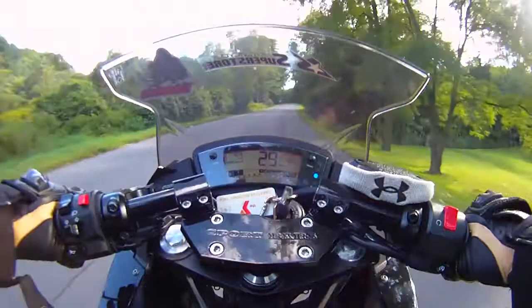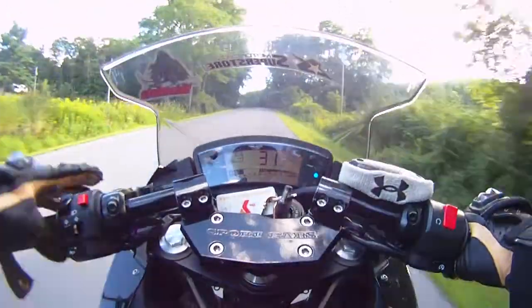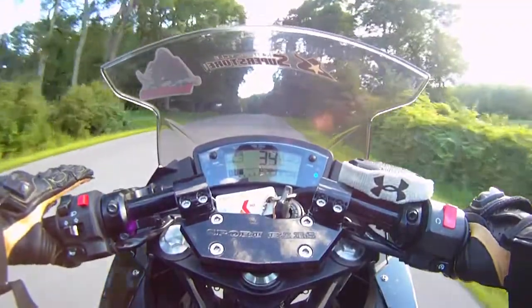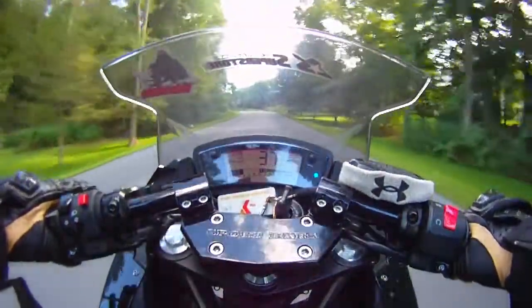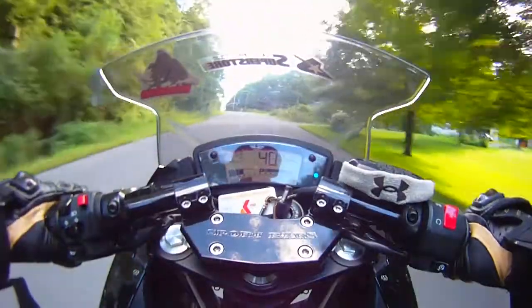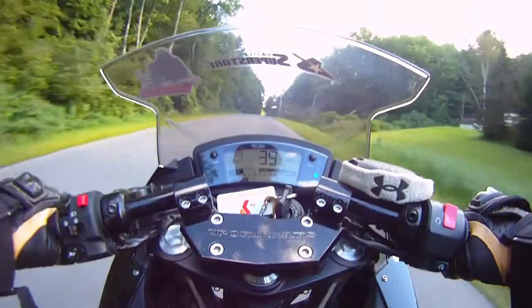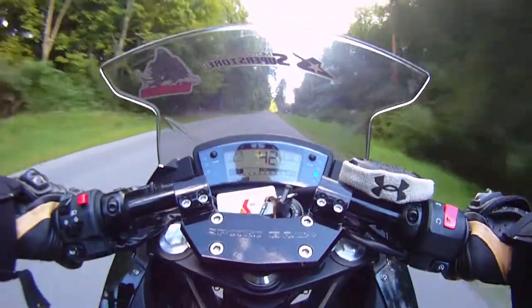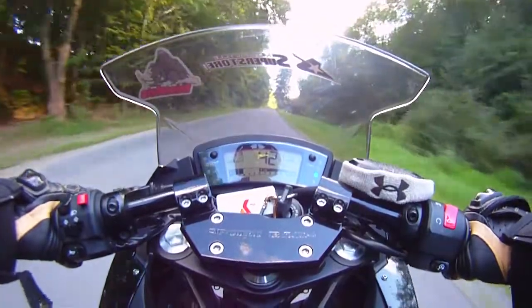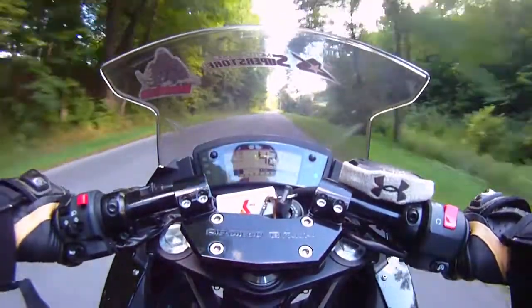So here we go, ready? We're gonna go up. I'll go up even higher this time. So, record. 5,000 up, pull clutch in, click up, and then I was at 5,000, and I matched it at about 4,000 to match the speed. Because when you pull the clutch in, you're gonna slow down.